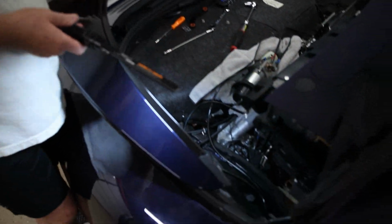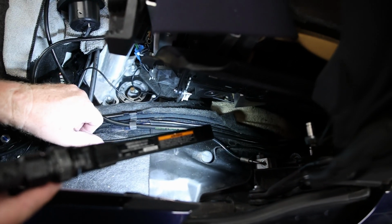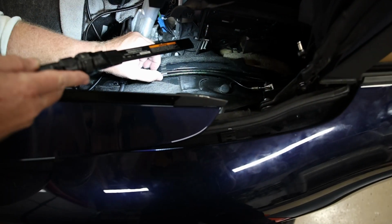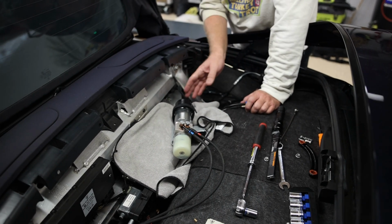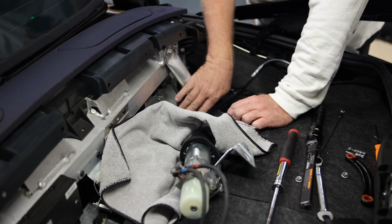Once you get the hydraulic ram in, then you have to make sure that you have these clips to actually hold the hydraulic lines routed. So there's one here, and there's one there. So the bottom one goes into this clip, and then they both go in this clip. So the routing of the hydraulic lines, you put it under this frame support here and make sure that it's actually under all of this right here.